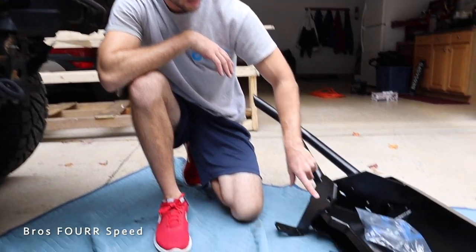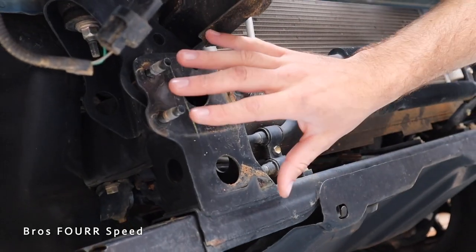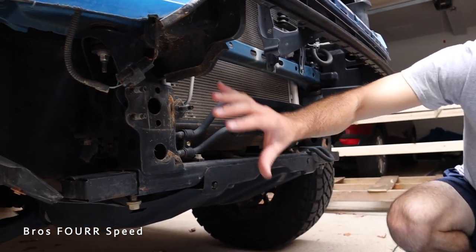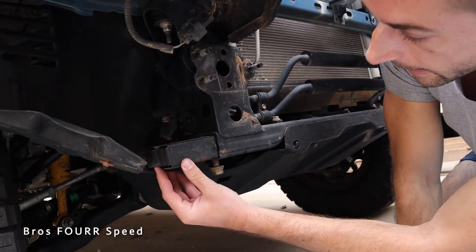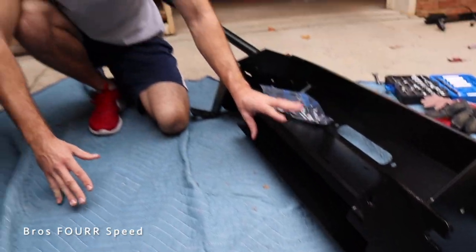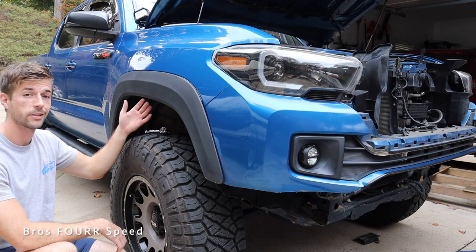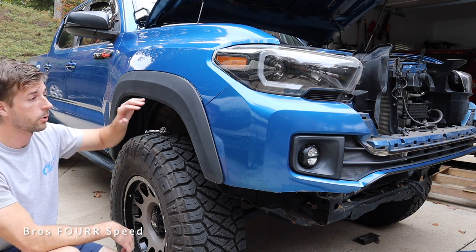For the mock-up, on the back side of the bumper you can see there are three bolt holes here on the truck. This is actually where the factory crash bar went — if you want to see how to remove all that I'll have that video down below, because it's already out of the way for us. We're utilizing this lower bolt right here, and we have this end cap that's threaded into it — that's going to be our bottom bolt for this bumper. Aftermarket bumpers like this replace the factory crash bar, which is why I don't have it anymore from that previous bumper.